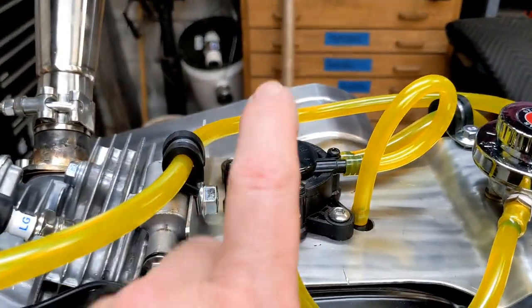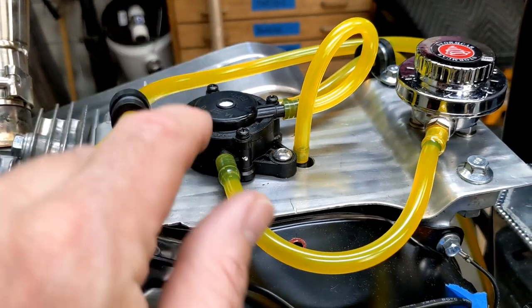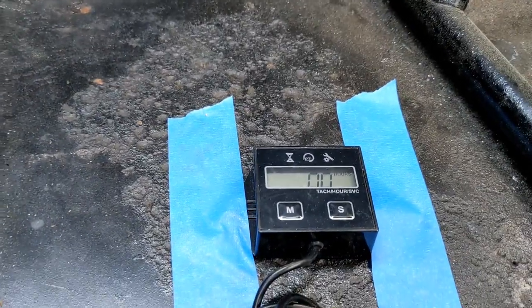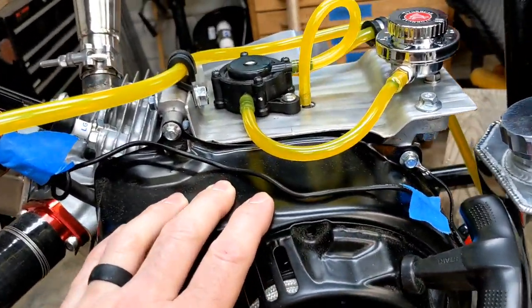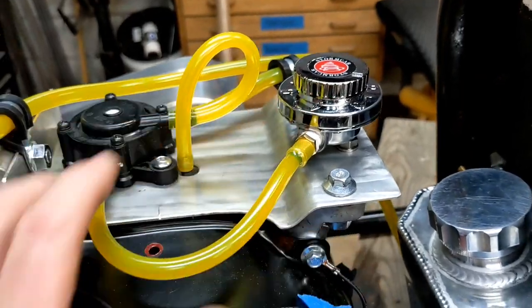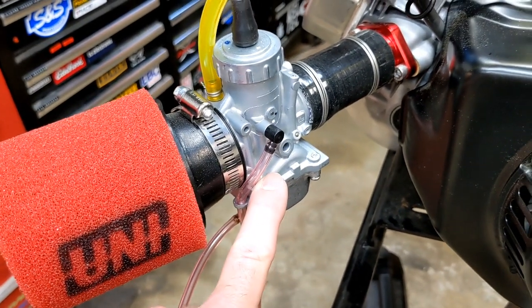So I thought I might have a pressure problem. This Walbro pump works on crankcase pulses. That's this line right here that runs around and works a little diaphragm. That's what pumps fuel. The issue might be this motor turns out is very high revving. I got a tach, which of course is reading zero right now. This thing will rev to 8,900 RPM, no problem. And I believe that it is because it's pumping so hard, it's actually overpressuring the system. So I added a pressure regulator. The other thing I did was adjust the float level in the carburetor, which was off a couple of millimeters.